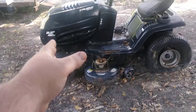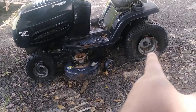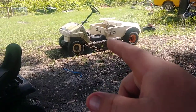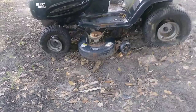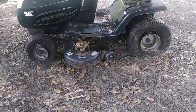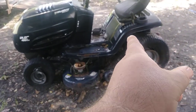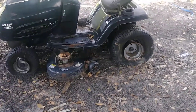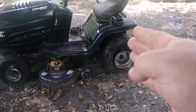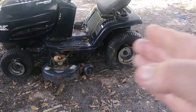So I got 51 inches from the front of the frame to the center of the rear tire on this golf cart. I have 32 inches from the front rail to the center of the tire, which means I need to remove about 20 inches out of this thing roughly. I'm going to shorten it as short as I can. Basically, right here behind the motor I'm going to cut that frame, and wherever the 20, 22, or 24 inches lands back here — either at the front of the tire or about an inch in — I'm going to cut it there too and then mate them together.